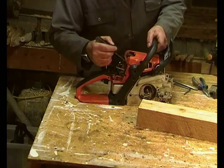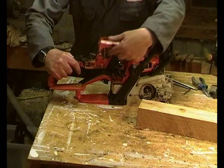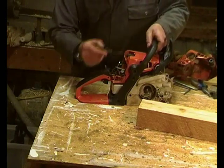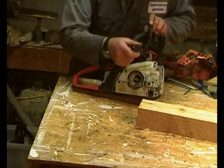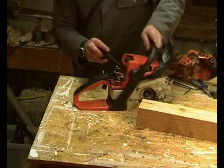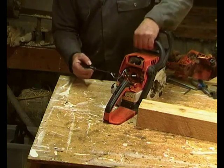And then this piece of case, which, if I can find another one, there's a big hole there, okay, which fits behind that bush. So you have to take that screw out, fit the rubber bush at the front here, which is not the easiest thing in the world, and start feeding all the bits through, getting the grommet in for the control cables, again a bit fiddly, and then getting the vacuum pipe.